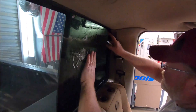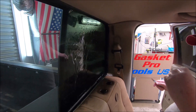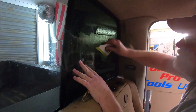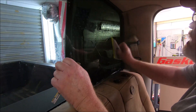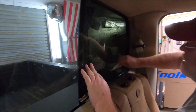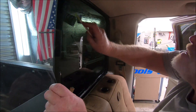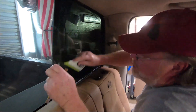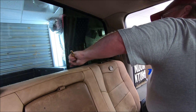This corner will butt up and touch completely up here. You'll have extra hanging over here and a couple other spots, but there's a reason for that. I'm going to hold it to the window and take this tool and tack it down right in the center. If I push it a certain amount to the left, I automatically turn around and push that amount to the right, just in case it moves the film. If I go up two or three strokes, I'll come down a couple. It's probably not a big difference, but I'm a creature of habit — once you start doing something a certain way, it tends to always work out better if you continue that route.